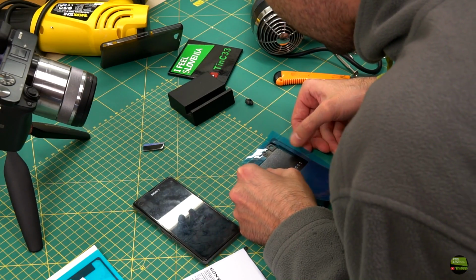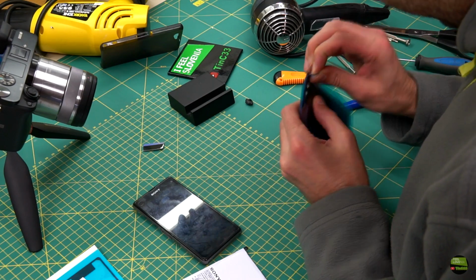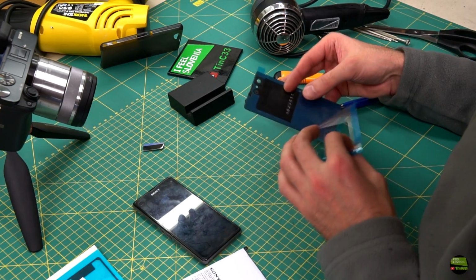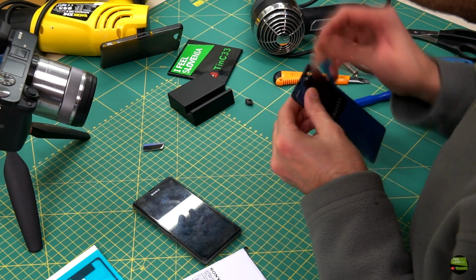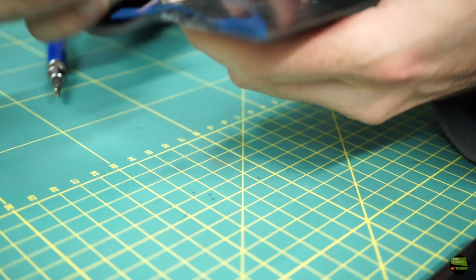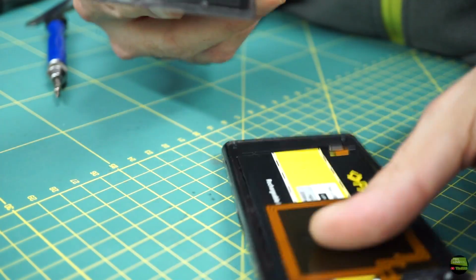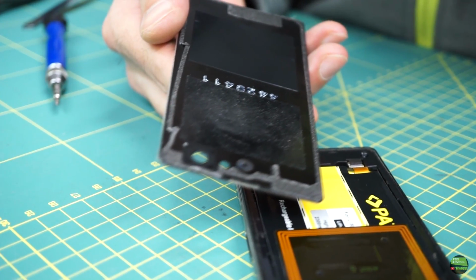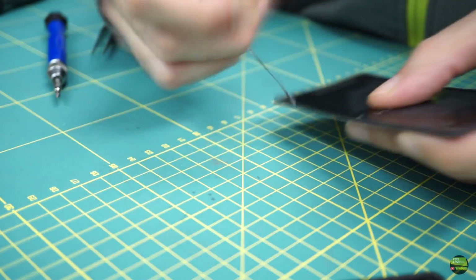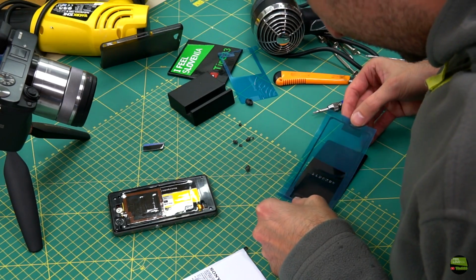The adhesive is quite difficult to install, because it's very sticky and so soft that it doesn't allow any corrections. I ordered 2 of them because I knew the first one would be only for a test. The first one is destroyed, so clean once again and apply the second one, if you have it, of course. The phone will work anyway, but if you don't apply the adhesive precisely, the phone won't be waterproof anymore.